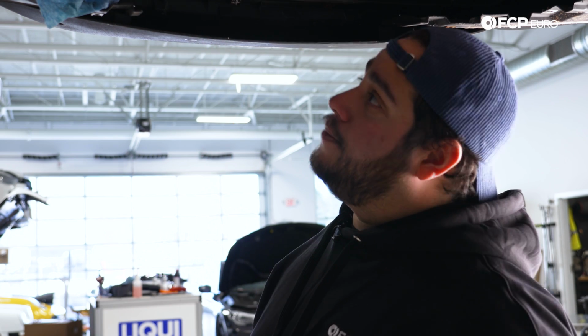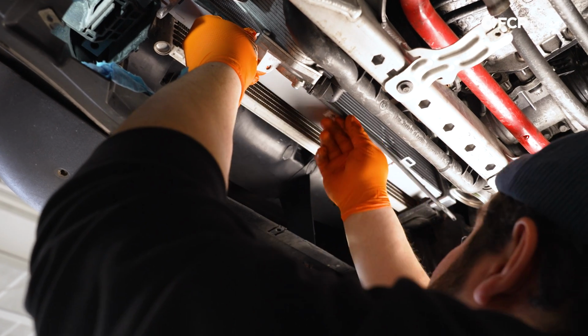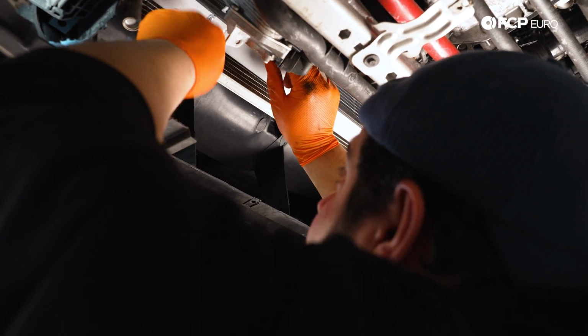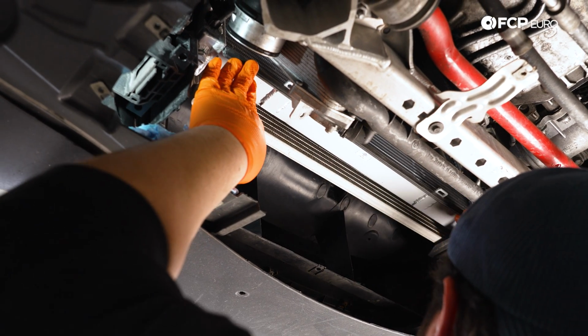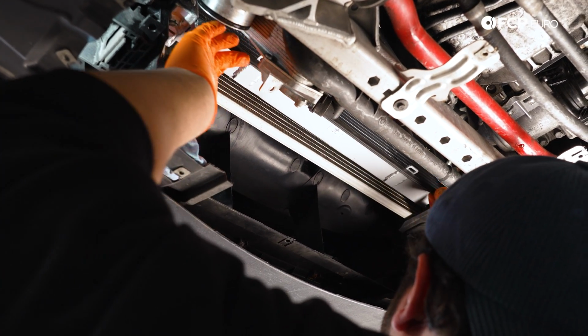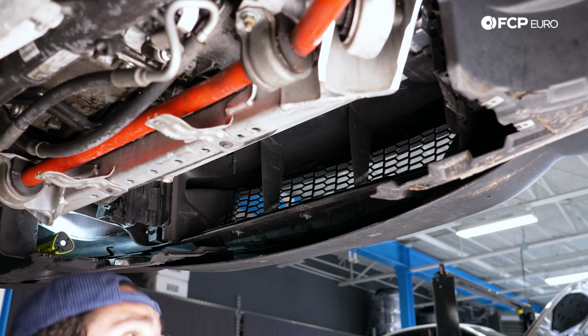back up. And again, if you haven't done so already, don't forget to check the drain plug on the all aluminum unit. They usually come in pretty snug and marked up from the factory. Just double check. Using a little bit of RTV just to keep it in there. These seals age over time and the fit may be a little bit different from the OE to the aluminum, but a little bit of RTV or some soft glue that can be undone should this need to come out again. And we're good. Now we can feed in the intercooler.